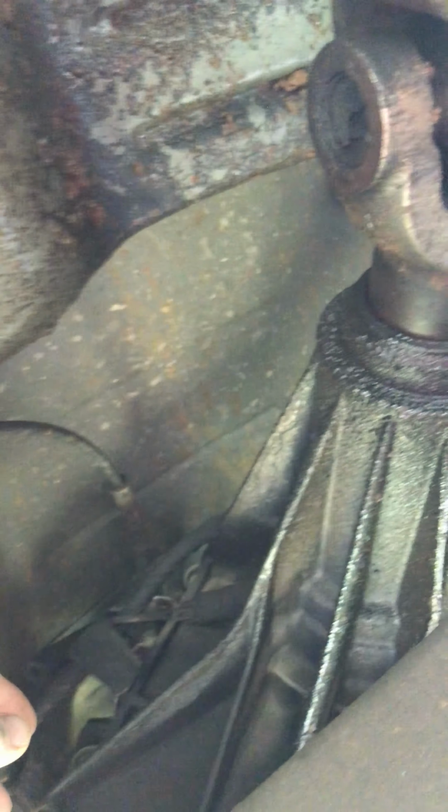Now the speed sensor is, I think, this plug. It may be this one over here. Anyways, with the 5-speed dogleg transfer case, there's only one of these sensors on here, and it will work just fine. It'll interchange and everything, so your speedometer will still work. Everything still works exactly the same. You just got a 5-speed transmission.